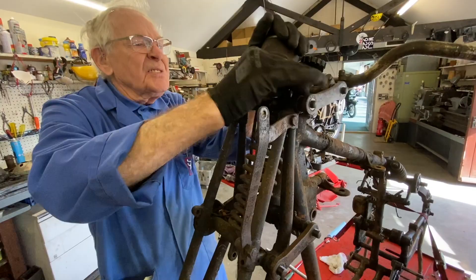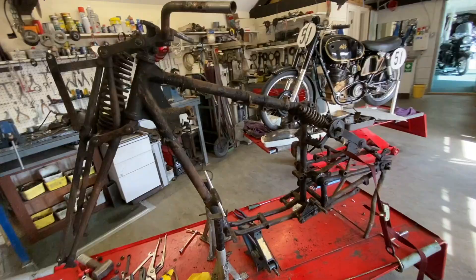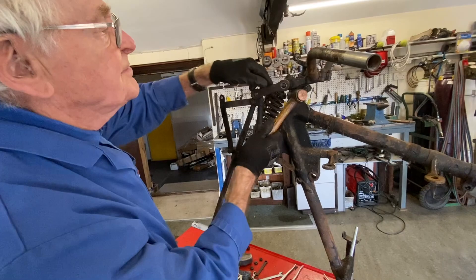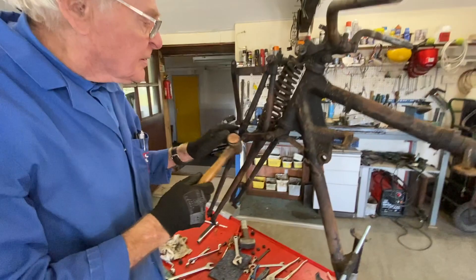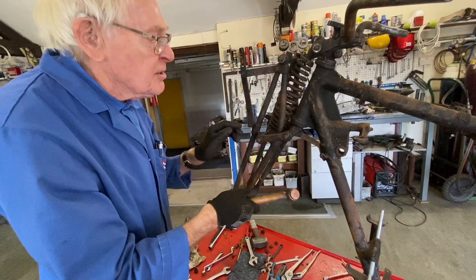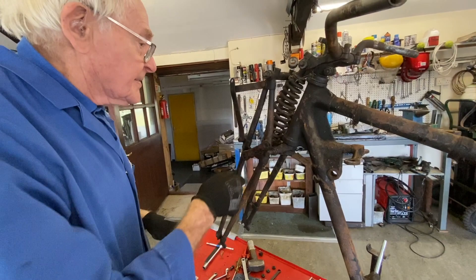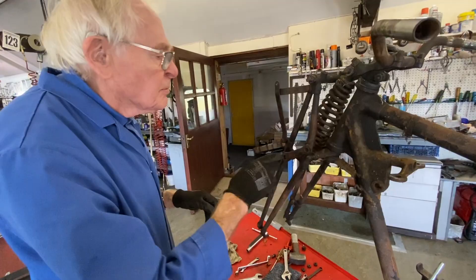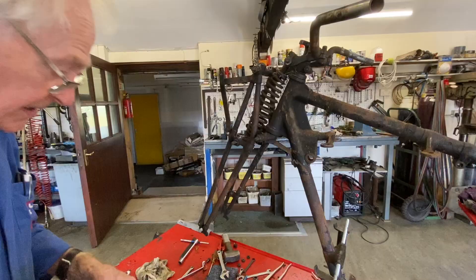Right, that's it — so we can lift that out complete with the speedo. The cable we couldn't get at was actually locked in there, so we can address that next. If we drop these links off, the forks can go out that way — theoretically, just a bit tight. With a bit of persuasion, there you go. Generally 'Druid' is marked on the side or 'Webb', but it doesn't seem to be happening on this one. The reason you use a copper mallet is because you don't damage the threads — if you hammer with a steel hammer you butcher up the threads. I'd like to mark those in case there's a difference — no, they're parallel. But anyway, I'm going to mark top and bottom so I can remember — that was the bottom, this is the top spring support.